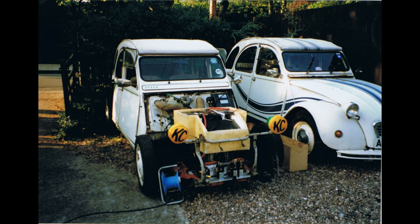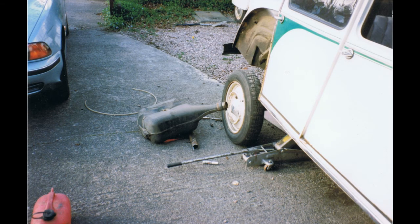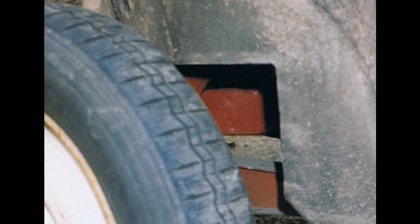We started to charge it up with a cable and charged it with a normal 13 amp plug, which did get quite warm because it should have been a 16 amp plug, but it just about worked okay. The next thing was to take some weight out of the car - one of the things we did was remove the rear fuel tank. I'll talk later about some of the other things we did to try and improve the car's performance and some of the things I was hoping to have done before I took the car off the road to improve its range and performance.